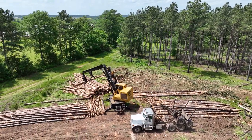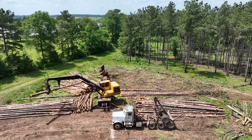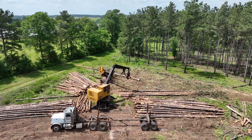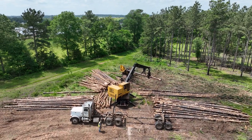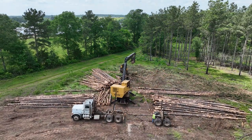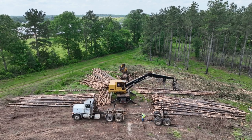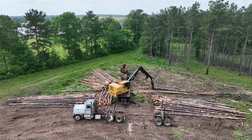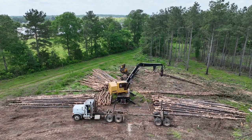To move forest products from the woods to a mill you need a log truck with a log trailer. There are a number of different types of log trailers and we'll see two in this video. The first is known as a stinger steer log trailer, and you can see it fully elongating. The part at the back near the rear eight wheels is called the stinger, and the bent piece of metal near the front eight wheels is called the reach. The operator is manipulating the stinger so that it can fully telescope. One of the advantages of the stinger steer log trailer is that it minimizes tare weight. In the state of Texas, log trucks with the right permits are limited to 84,000 pounds — that's a regular permit limiting the truck to 80,000 pounds gross weight plus a five percent overage allowance with another permit.